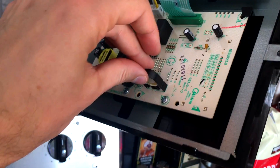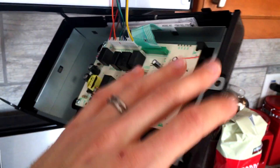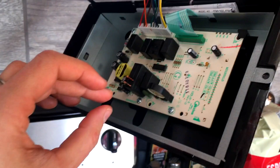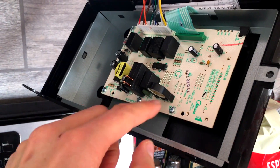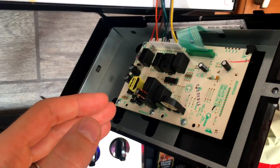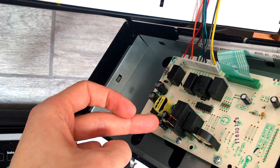All you have to do is wiggle this little guy. Of course, you're going to want to stabilize everything, but gently wiggle, wiggle, wiggle until this buzzer pops off. Get some wire cutters. Make sure that the little nubs are nice and clean so that it's not going to touch anything, and then you're just going to put this right back on those prongs like so.